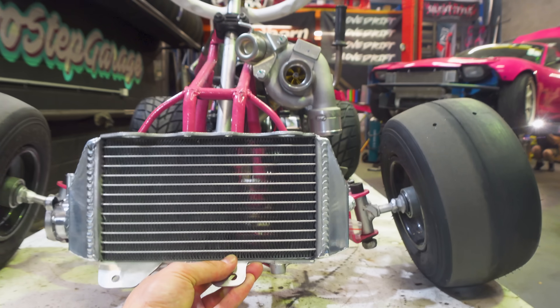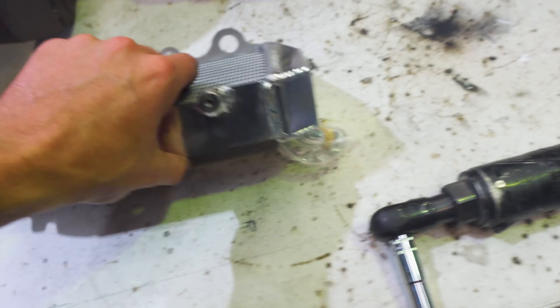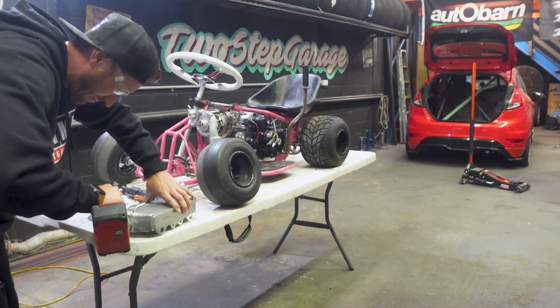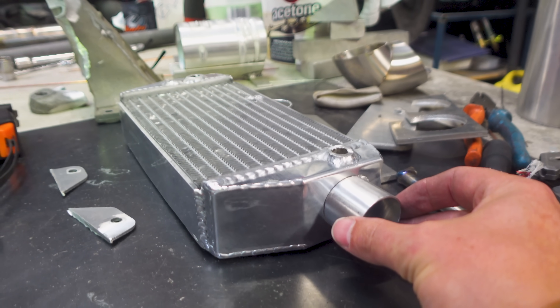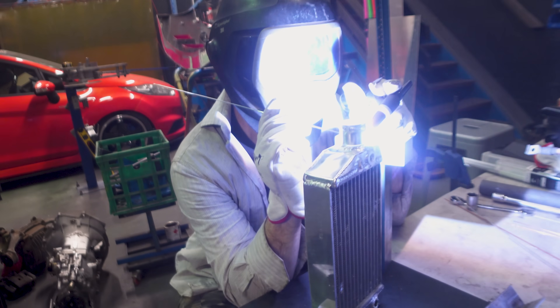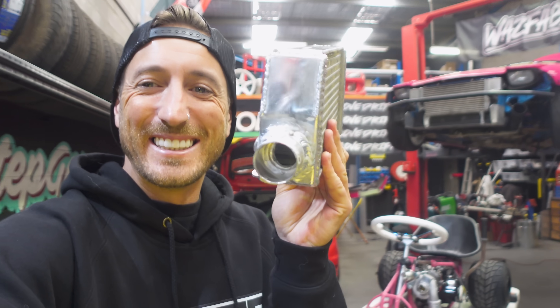This right here would look so freaking awesome. Now I'm sure a bunch of you guys are watching and saying, Mike, that's a radiator — you've got a random cap and random hoses coming out of the end tanks. Well, luckily Woz is a fabricator here at the shop and he can fix that problem for me. First things first, we need to chop everything off this radiator that we do not need. We're adding 1.5 inch intakes to the end tanks to transform our Kawasaki 450 radiator into an intercooler for our 125cc motor. We're also filling in all of the holes from the unused pipes that we cut off the radiator. And just like that, we have our front mounted intercooler.